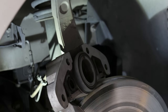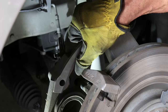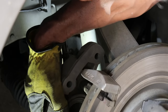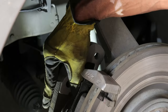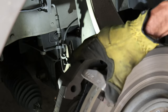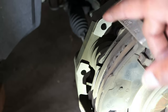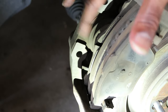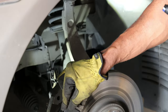Take your pad out, line up your caliper on those guide pins, then just drop your brake pad in there and bring it over and clamp it into place. I did forget to mention: this is the passenger side. If I was doing the driver's side, that slot right there is where your brake indicator would go in. You want to make sure that the brake indicator is pointing towards the rotor.